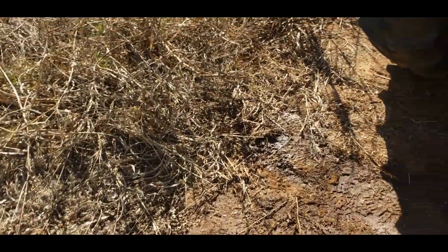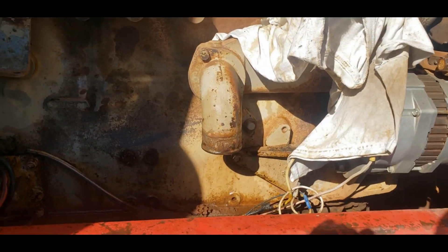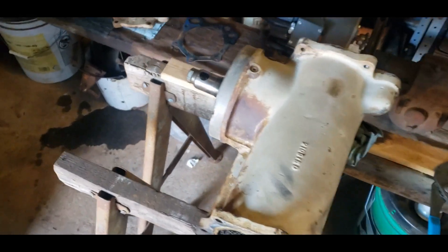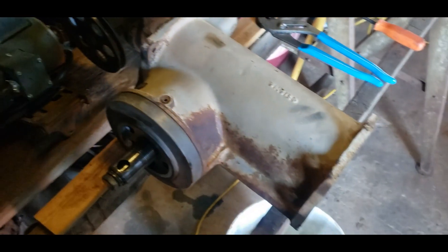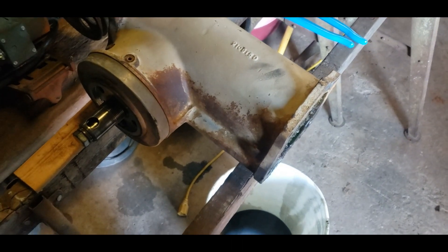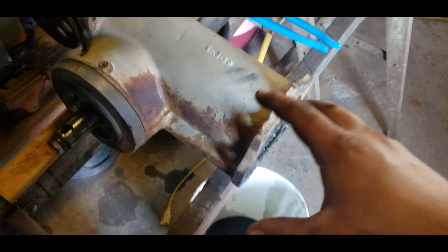The engine's cold now, so it'll be interesting when I go to flush it when we're all done. Anyway, here we have the oil cooler and the back plate. This is where your oil filter spins on — it's a B96, that's the Baldwin number, and you can use that to cross to something else if you want. It's a cast iron housing and the cooler core sits inside.